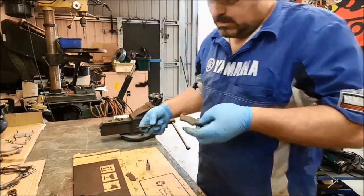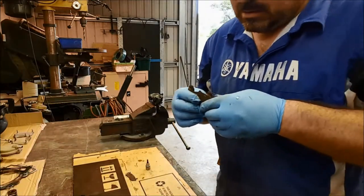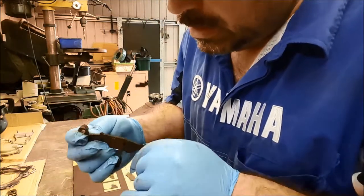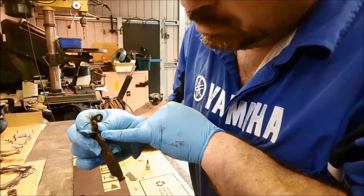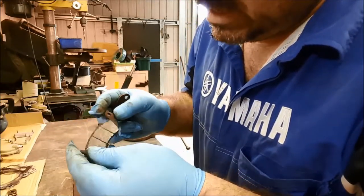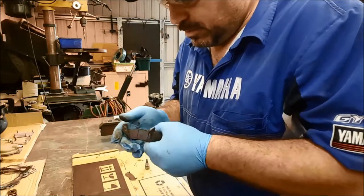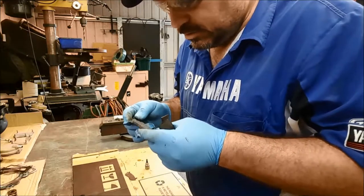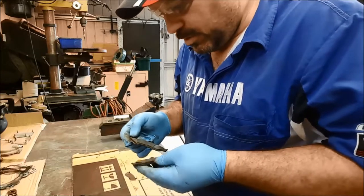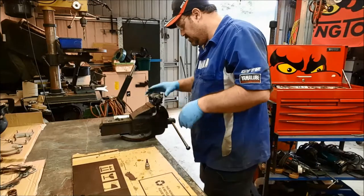Brake pads, they're getting way down. In fact, they are essentially a warrant fail. Once you get down to about 1 millimeter of material on the brake pad, they really are beyond manufacturer's minimum spec. So those pads are going to need to be replaced. Chances are the customer won't want to pay for that, but if he wants a WOF, and if I'm going to give him a WOF, he's going to have some new brake pads. Okay, so brake pads to replace, and grab some of those this afternoon.